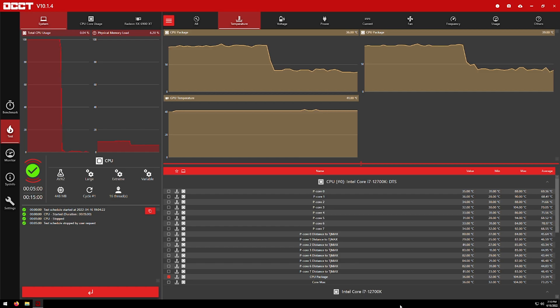I will not be using liquid metal — specifically Thermal Grizzly Conductonaut — on top, and I'll explain this later. It's a copper surface touching copper, which is not a fun time. So I'll be using KPX as well. The only things I'll be changing are the actual interface material and the IHS.